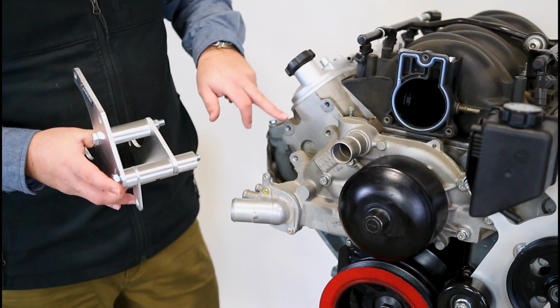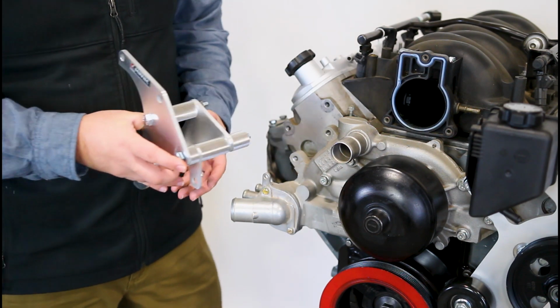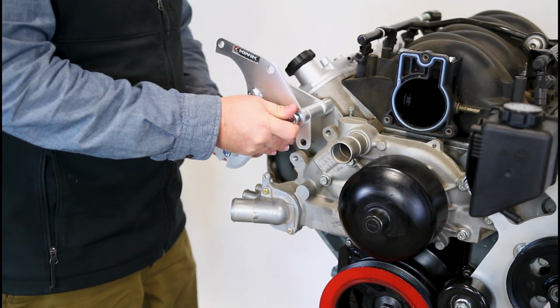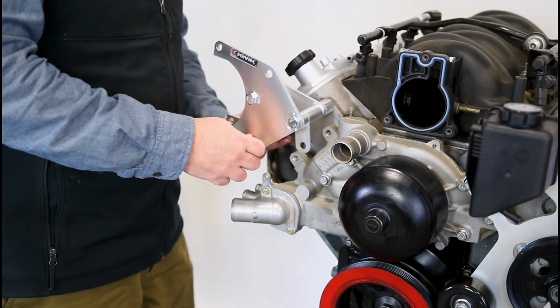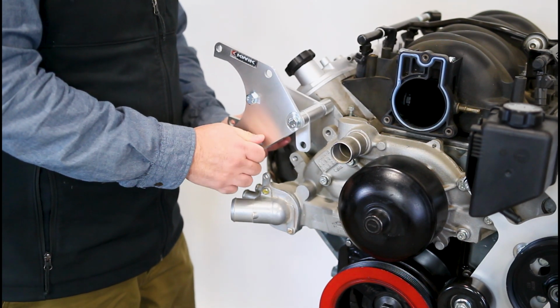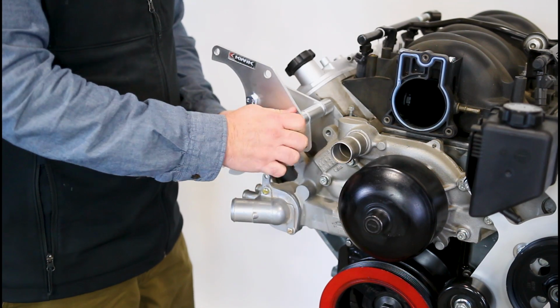onto the engine cylinder. We have our bracket assembly ready to put onto the 2 cylinder head bolts here. There'll be the 2 spacered units there, and we're just going to get these started out. We're going to leave things pretty loose as we go. Just want to get it to a little less than finger tight.